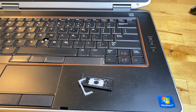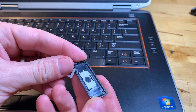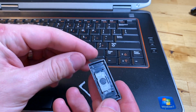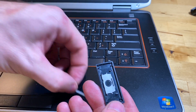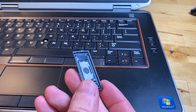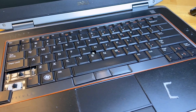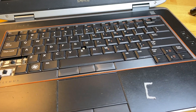I wanted to get a close-up of these keys. They're really similar to the ThinkPad — any of these scissor key mechanisms are very similar. On this one, I'm choosing it because it's the most complex. Many of the keys only have these little scissor mechanisms which hold them in place. The longer keys will have a metal bar, and that's just one extra step you've got to be mindful of.